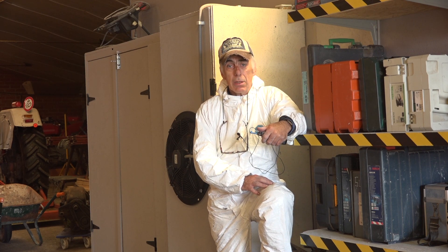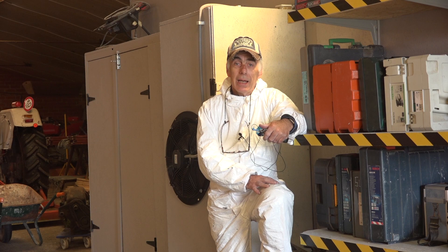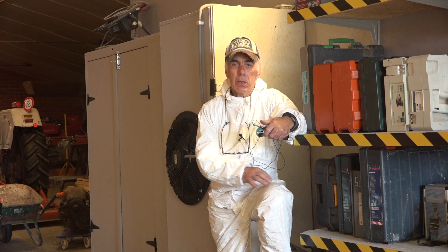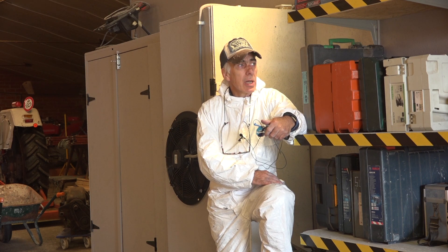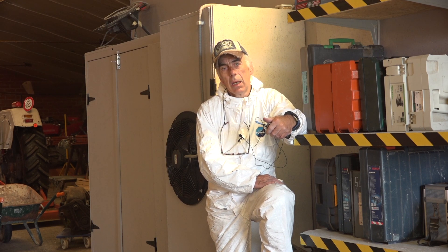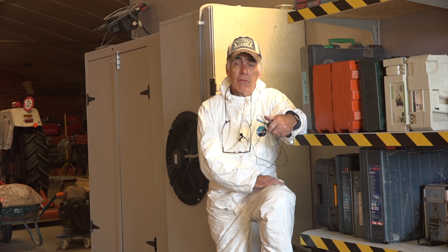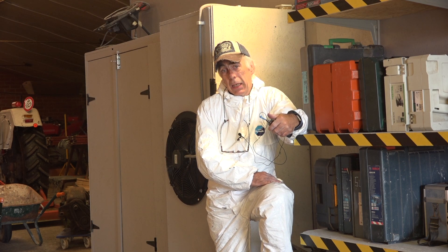This was the maiden voyage of my paint booth and I think it worked quite well — I have almost no dust, just two or three small particles probably coming from my own clothing. If I had to change anything, I would probably put a bigger filter in — maybe double the size. For bigger surfaces you might have a little issue with fume build-up, but that was never the intent of this paint booth anyway — it wasn't designed to paint a full car.